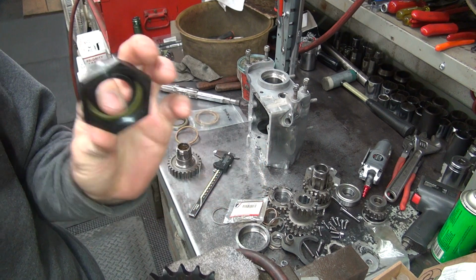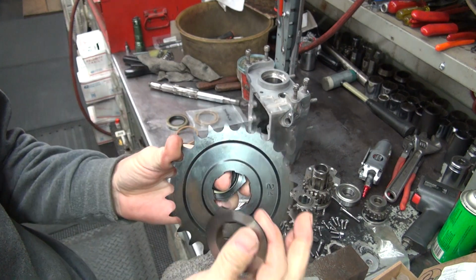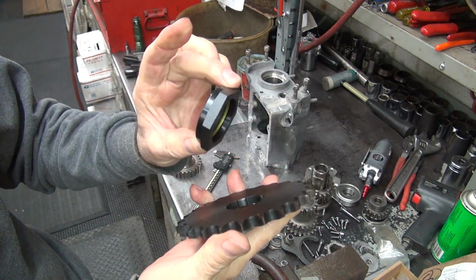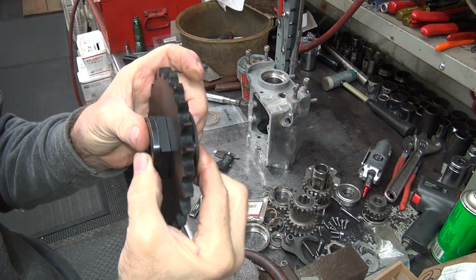Once the nut's loose, it doesn't matter if it's got 5 thou clearance or an 1/8 inch. It's loose. This is still going to leak. And most of the bikes I pull apart, take your finger on the nut and the nut's loose. So they're leaking anyway. All right, so these are all things I do to make your 4-speed not leak.